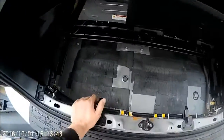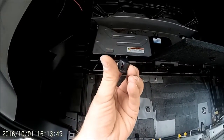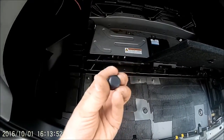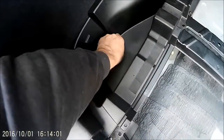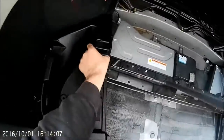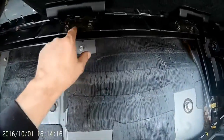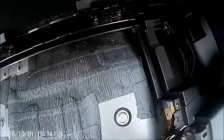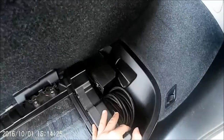Last but not least, you'll have a little plastic nut - I was able to undo mine by hand but it's probably 14 or 15mm, maybe 13. That's located in there; you unscrew it anti-clockwise and then your tray pulls out once it's off the locating pin. To do the other side, exactly the same: undo the four bolts at the back, take out your plastic poppers, and then this side of your tray on the right side pops out.